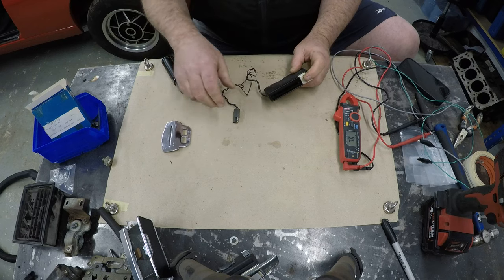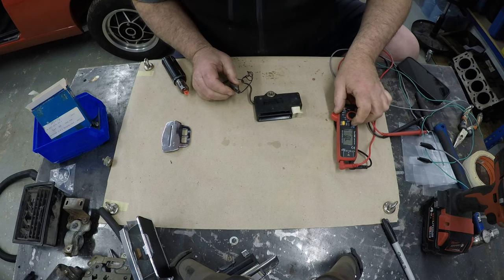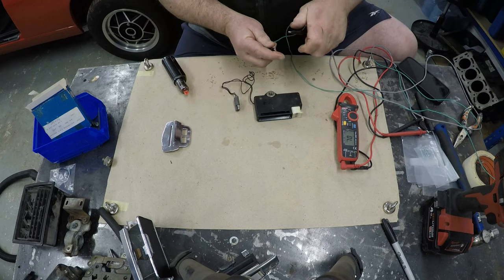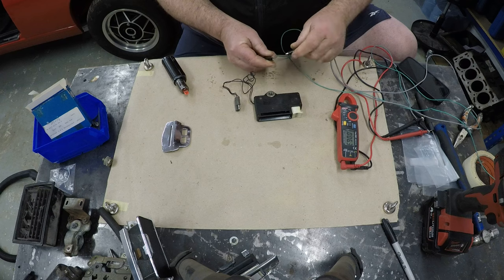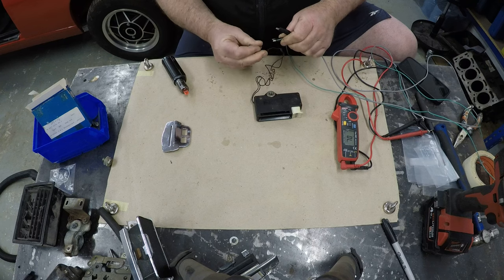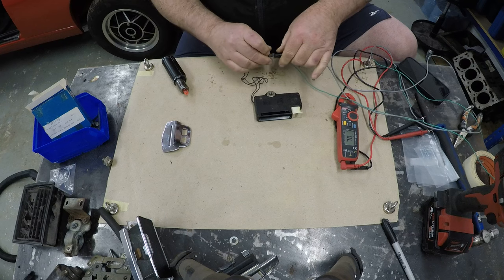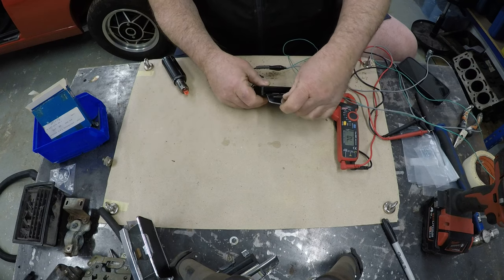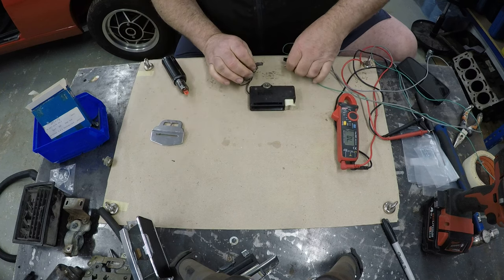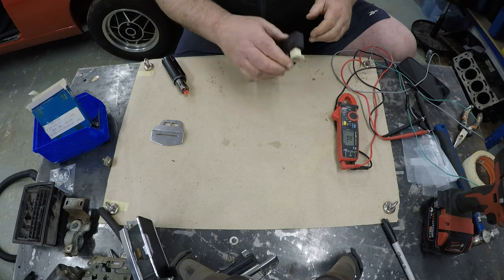So this one doesn't work. The easy way to test that is I've got a test meter here, just set to continuity - it'll beep when I've got a closed circuit. This should beep when I connect it now. And as you can see, nothing. You can try putting the seatbelt in a couple of times to loosen things up, but it's just not working. So at the moment the micro switch isn't connecting or disconnecting inside - whichever way around it's not touching, which is the key thing.